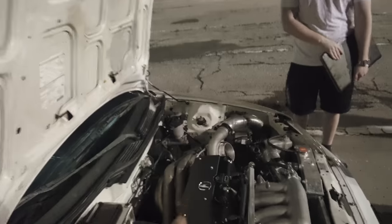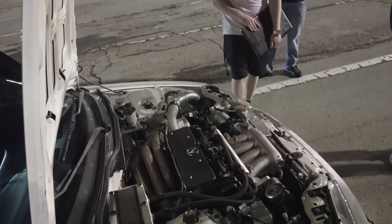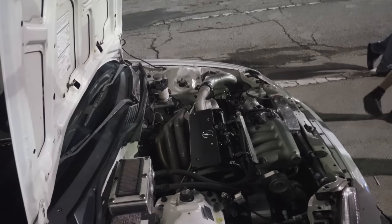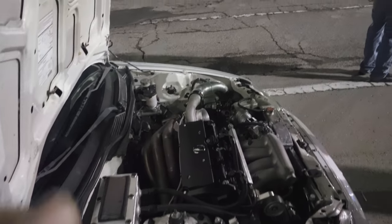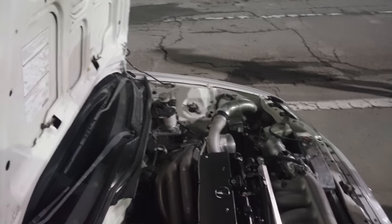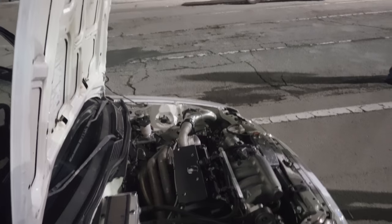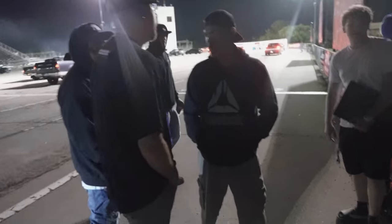That last pull, the car had issues going into second gear — the clutch rod was a little too far out. I took the whole rod out to get the clutch all the way in. Power-wise, we now have the boost solenoid maxed all the way out, so the turbo is going to make however much power it can. We also changed the launch a little bit since it was spinning — took it down to see what she can do.